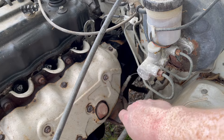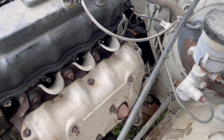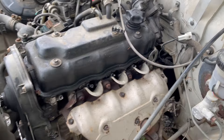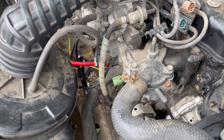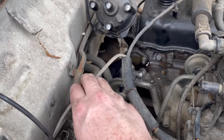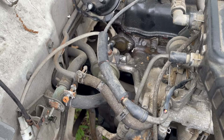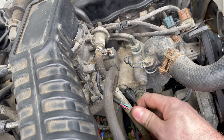I'm going to order a wideband O2 for right here. This one I think is just a warning light for like low brake fluid — I'm going to see if I can get that going. These plugs go away — they're part of the distributor, which is being deleted. There was another plug and here's a pin I'm not real sure what it does, like a blade connector. I think this one is just a warning light for something, so that's going to go bye bye.